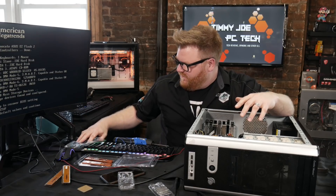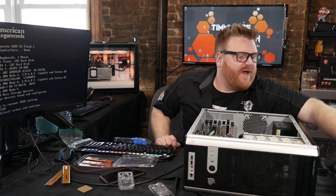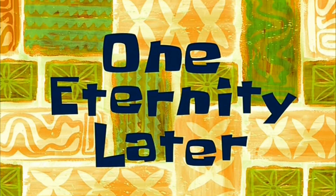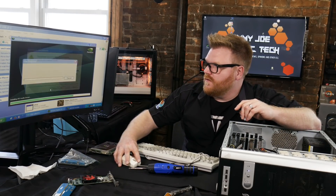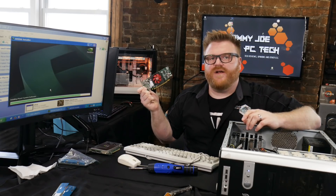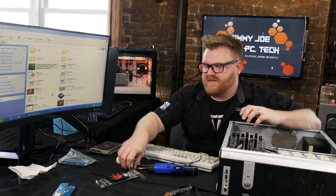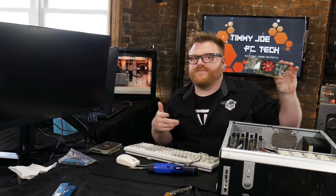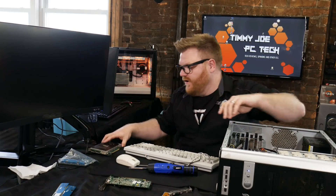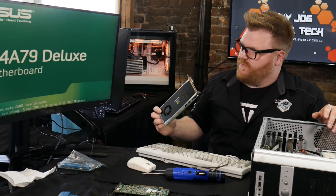I don't really want to give up my 8 gigs of DDR2 memory, but it's been a long time. I had some nice G-Skill stuff here. I tried this ATI card and it works fine, but it's a 6450 Dell something. When you load the driver there's a stop error and it just keeps using the basic display driver. Not sure if the card is broken or if it's a wrong driver for XP. So I put another Quadro in it — an FX1800 with two DisplayPorts and a DVI.